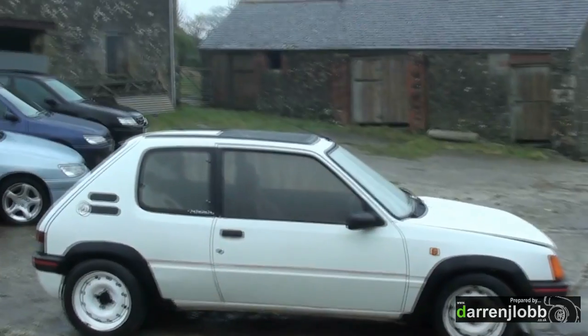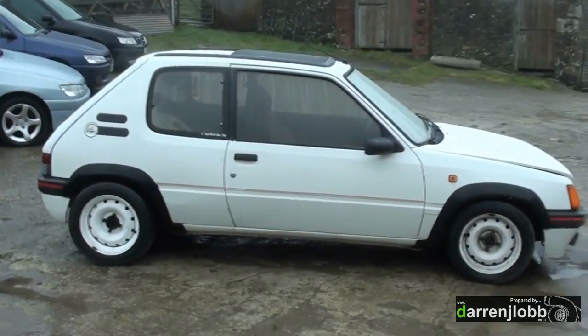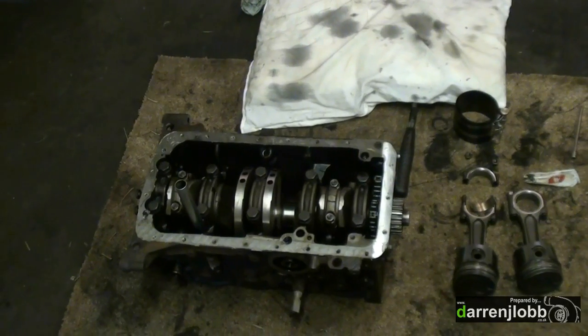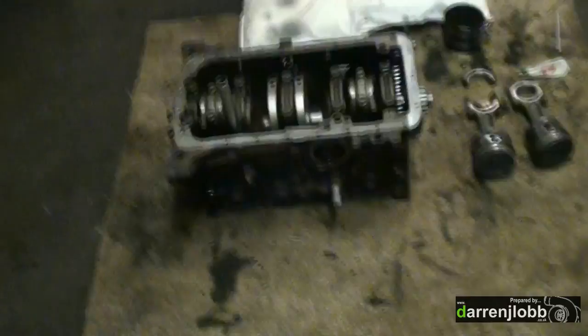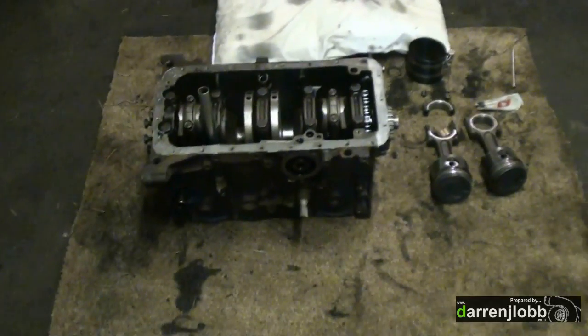So it stayed here. I just tore the engine out of it. Well, actually the head's just off because it basically smashed the bottom end up. So we're going to build up a new engine. On the floor here we've got a donor engine block. Tom actually picked it up himself and dropped it in here. I can't actually remember what it's out of, but it's just a standard XUD. So I'm just going to tear this bottom end completely apart now — pull all the rods and the pistons out of it. As you can see, I've already got two out.